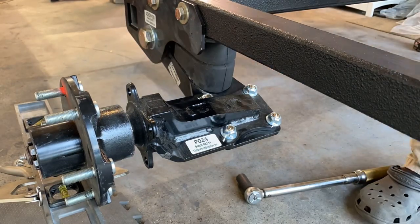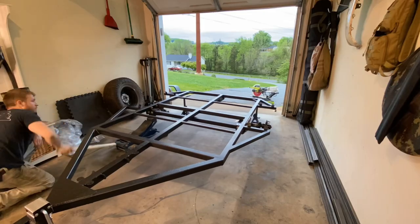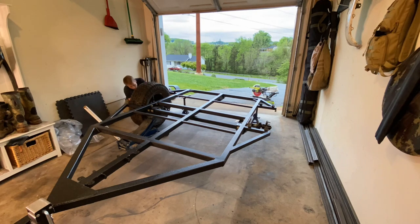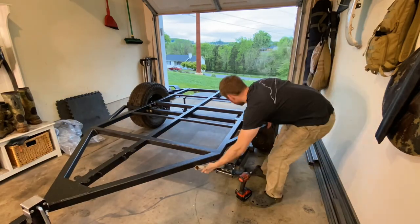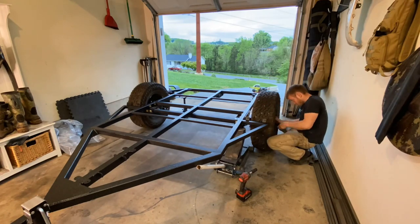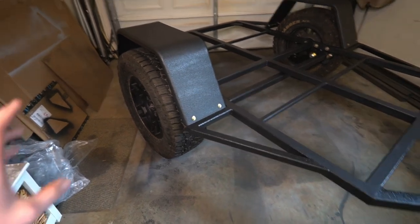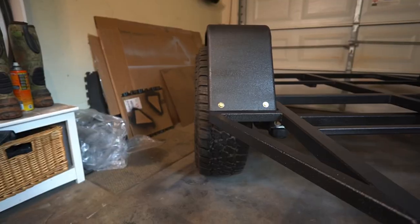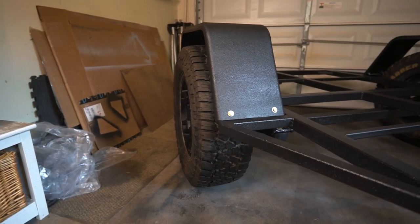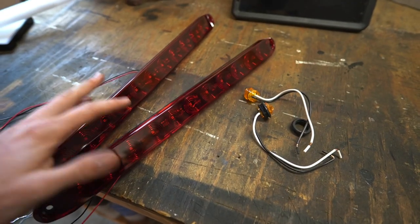With the toe set on our trailer, we're going to run around and torque all the bolts to 90 to 95 foot-pounds and mark them with a paint marker as a witness mark so we can see if they ever loosen up in the future. Now we can go ahead and get our wheels on. If you're using Toyota wheels that use OEM-style lug nuts, there are special lug nuts on Amazon with the correct thread pitch and shape for Toyota wheels — those will be linked in the description. We went ahead and threw the wheels and fenders on; the poke looks pretty good out from the fender — a nice aesthetic, not poked out too much or sunk in.